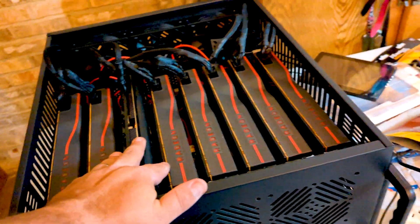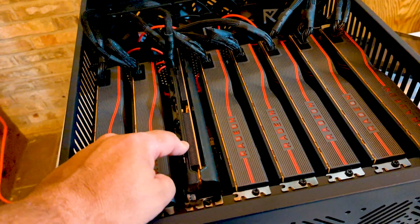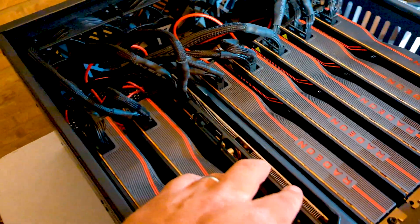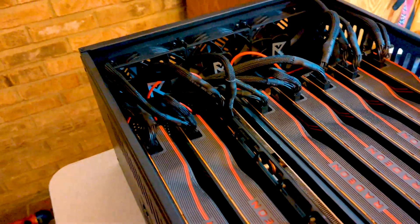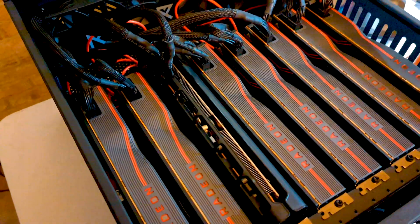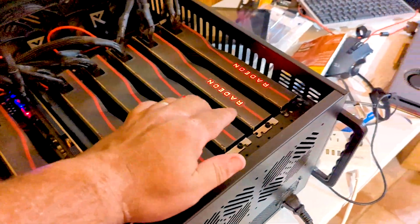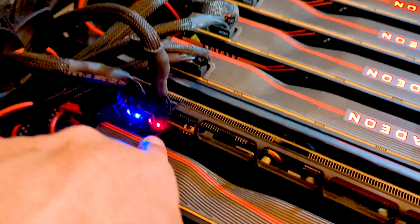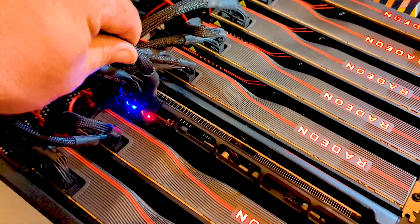This was our error culprit - card seven would run fine, and it was like, okay, what's going on? So I plugged in an XFX double dissipation card, and lo and behold when I go to turn this on it's actually giving me the error. You can hear it get loud for a second because this case is pretty loud. You can see everything fire up - right here's our problem. The blue is good, the red is bad. So this 8-pin is my problem.